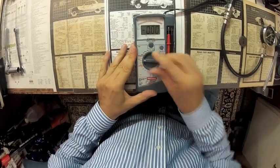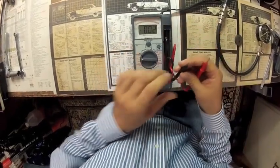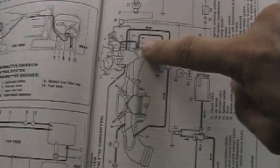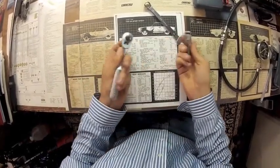One manual has a flowchart section to help root out common things that could go wrong. Learning to use a multimeter will help you trace electrical faults in switches and lights, all of the circuits, including the electronic fuel injection system, just by tracing the diagram and using the test points they show you in the manual. You'll still use common tools like this metric combination wrench, or a ratchet and a good set of sockets.